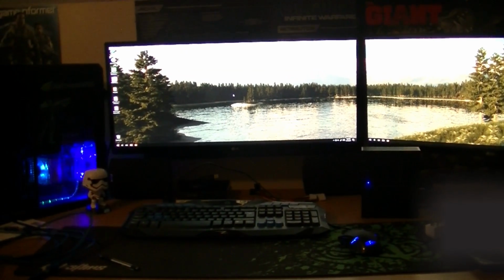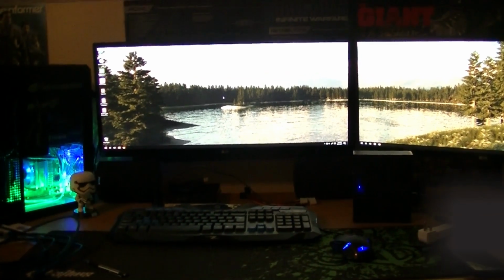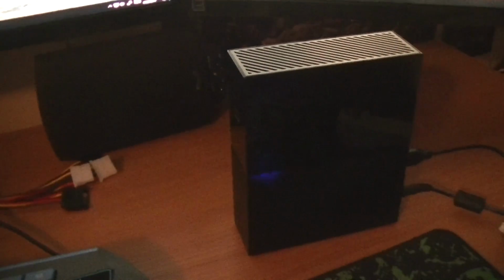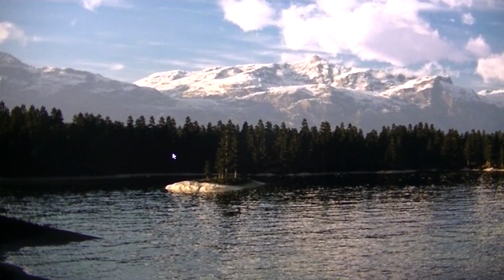This portion of the video, I'm going to show you how to set up your WD MyBook external drive, network NAS. First, what you have to do is plug the power cable in and plug in the drive. Then you run your USB cable into your tower, your PC, and it should activate the drive.